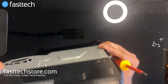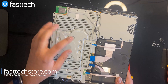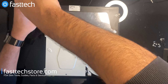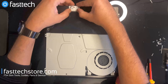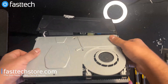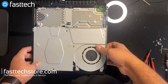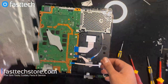There's going to be the power supply that we need to remove to get this panel out of the way, because there's a screw that runs through the power supply and into the board, and also one from this side. Now that this side's out, we're going to remove this cable and pull it out. Now we've got the power supply out — flip it over.